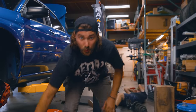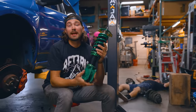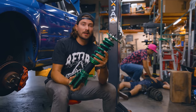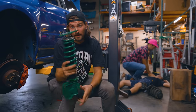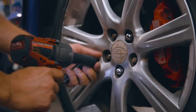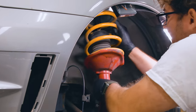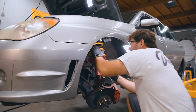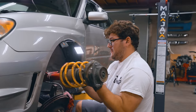Sometimes you're going to have to do a little prep work before your coilovers are ready to install. You might have to install some top hats, and you're probably going to have to adjust the ride height to your liking. Luckily for us, our top hats came pre-installed and these things are ready to throw in the car. There's the first coilover.